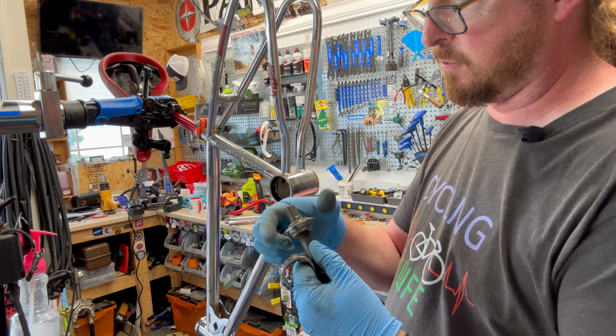So I'll put this in the vise, crank it down tight, maybe put a drop of Loctite on the threads here to hold this in place, and then use the other side, which is supposed to be your adjuster side, and press in the bearings. I think I got it figured out. Let's clean these bits, keep cranking on the ultrasonic, and we'll throw it all back together momentarily after this.